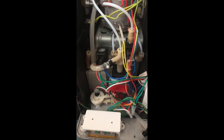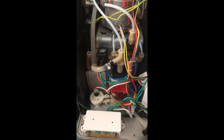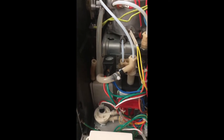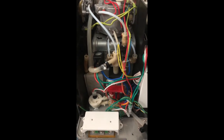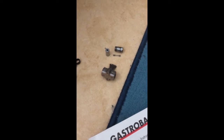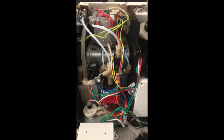If you open it up and see water damage at the bottom, be very careful when reconnecting it to identify where the damage is coming from. In most cases you can locate it by following the trail of corrosion. If you don't feel confident, let someone else handle it. The valve itself costs between 25 and 30 euros. A local repair shop would charge around 150 euros maximum for the repair work.